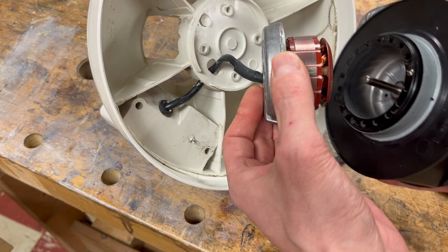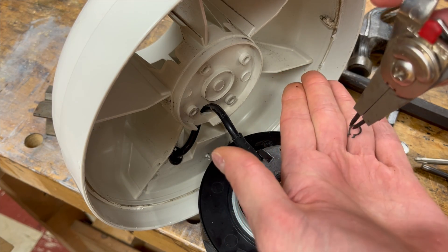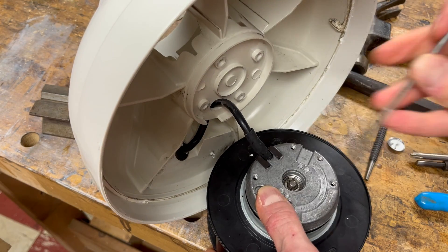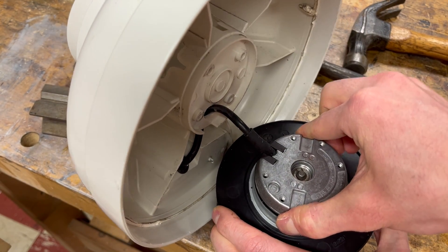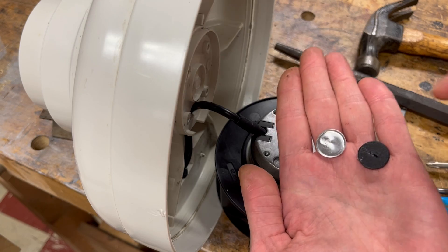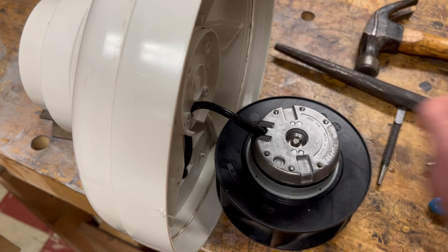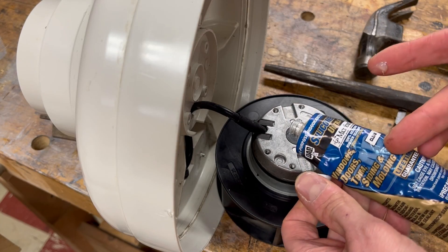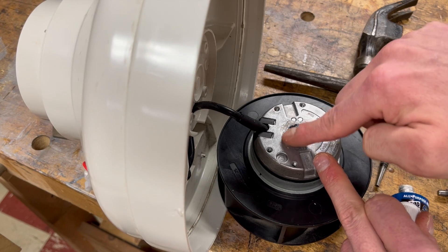We can take our washer and put it back on top, with the spring down inside there. Then we can take our motor and put it back on. Now we can take our retaining clip and put that back on, and just take a screwdriver to make sure it's seated really well. You can test to make sure the motor does not pull back out. I have a 3D printer so I just made a nice plastic seal exactly the right size that slides right in, and then I'll run a small bead of silicone around the outside to make sure no moisture gets into this hole.